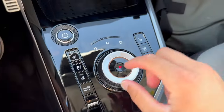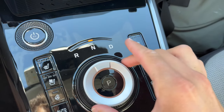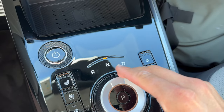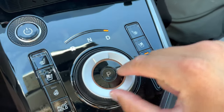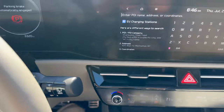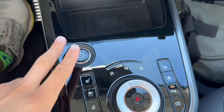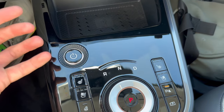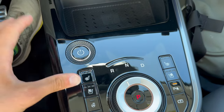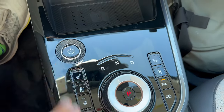How do we actually get this car into drive? Foot on the brake, then use the selector to go between reverse, neutral, or drive. You'll know which one you're in because there's an indicator light over it. When you're done driving, press P for park. Unlike some other electric cars, you do have to press the stop button when you get out. It's less intuitive in electric cars because you don't have engine noise, so make sure you press this before you get out — otherwise the car will chime at you and stay on when you leave.